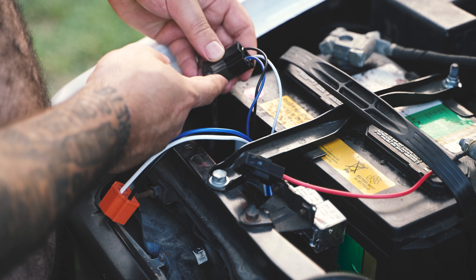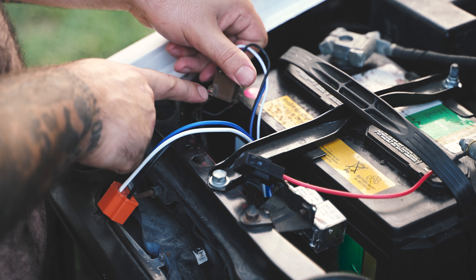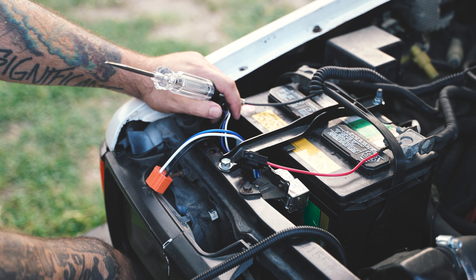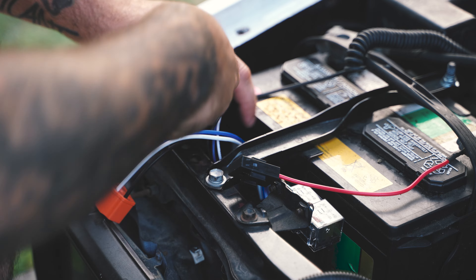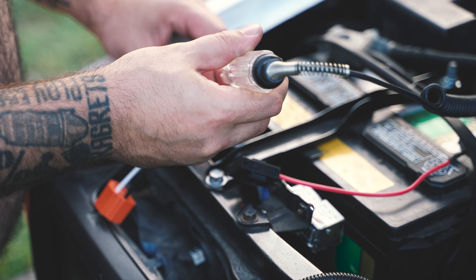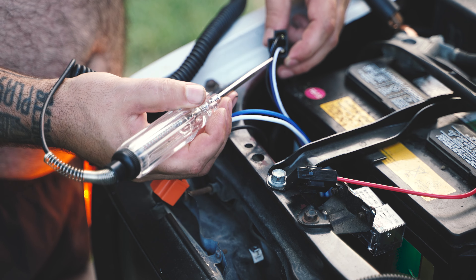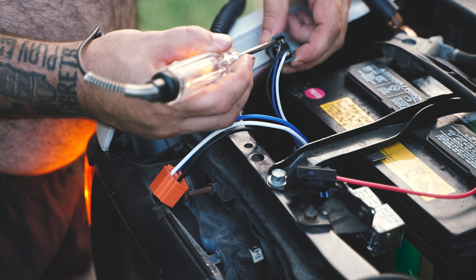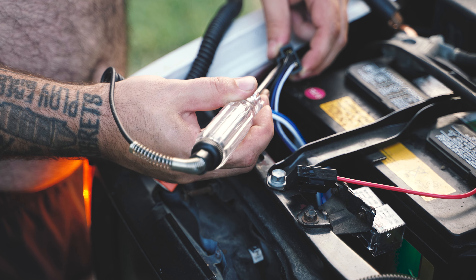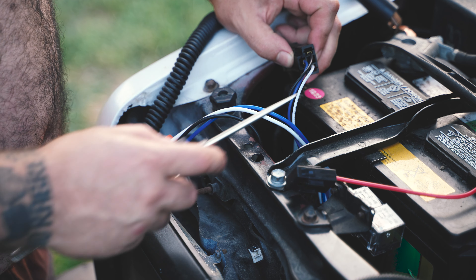When I switched my headlights on I was able to use one of these cheap little test lights to figure out which of these three were hot on the stock Toyota female three-pin connector. The wires go into the side at a weird angle, so I put my tester in there and figured out where the power was coming out. There are three terminals: black, white, and blue — left, right, and bottom. The left one lights up, the right one lights up, and the bottom one does not.